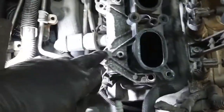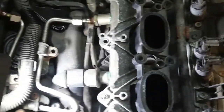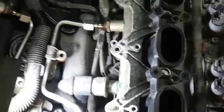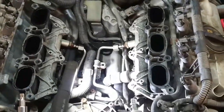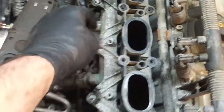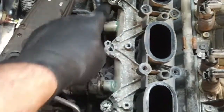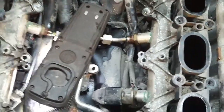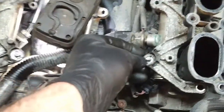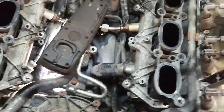I've removed all the fasteners from the fuel rail and the lower intake manifold section — the service literature says just remove it — but mine appeared to be stuck, so we're going to have to figure out a method of removing it. I got the high-pressure lines disconnected. The service manual says after you remove the fasteners just simply remove this aluminum cover, but mine is corroded onto three dowels and I can't get it off. I've sprayed penetrating fluid on it and I'm tapping on it but the dowels are not releasing.